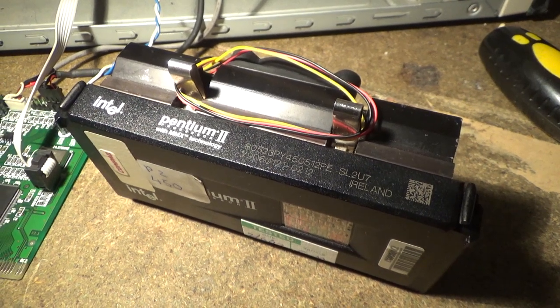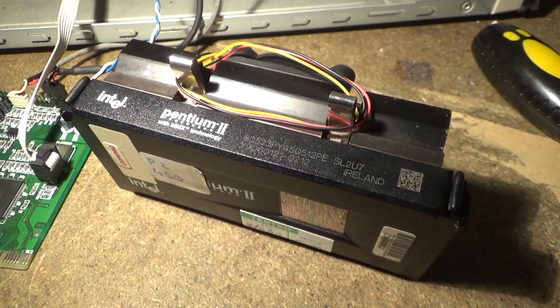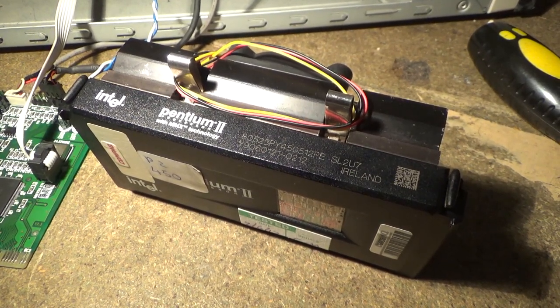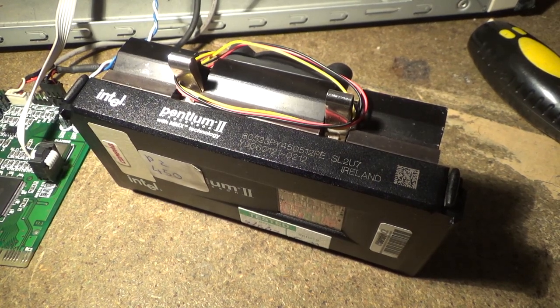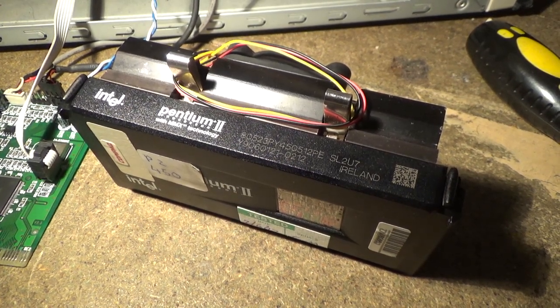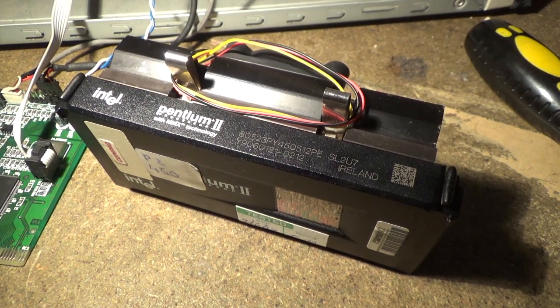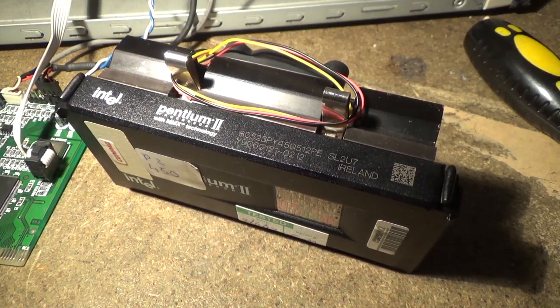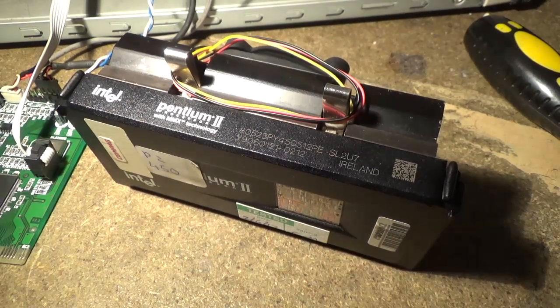It's just like the one I had before. These were good CPUs, but they seem to be far less common than the 400MHz model, likely as they didn't come out that long before the Pentium 3 models did, that would work in the same motherboards, usually. Given the Katmai had half-speed cache as well, you had to wonder how it actually holds up, clock for clock. Was it faster, or was it just a marketing gimmick?